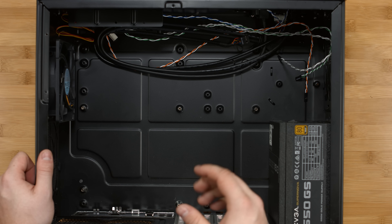Our HD audio cable is next. Before we install the reset switch, power switch, and LED indicators, refer to your manual to make sure you get the correct orientation. The first cable we're going to plug in is the power LED — the green wire is positive. Next, let's install the hard drive LED, then the reset switch, and finally the power switch. On this motherboard we have two chassis fan headers; we'll be using the first one for ease of installation.